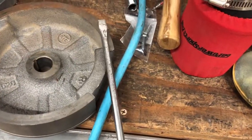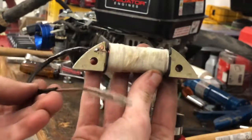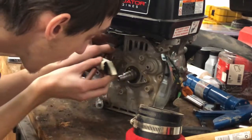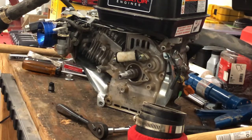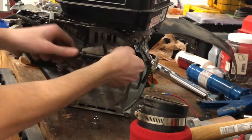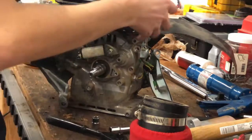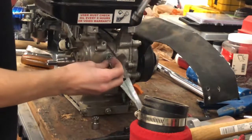There is a two-by-two square hole pattern where the charging coil will mount. Use the top two mounting holes and your M6 bolts to install the charging coil. The cable extruding from the coil will run under the flywheel and out under the gas tank — make sure there's proper clearance so the cord does not get caught in the flywheel. The shroud shield on the right side of the engine — the one not shielding the cylinder head — has a bolt to remove with the 8mm socket; the starter solenoid goes in its place.